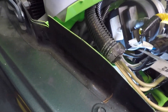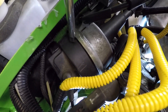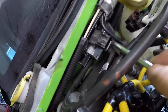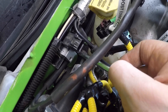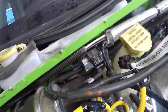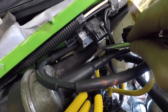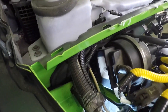Off of solenoid one, there's a gray line which goes back around the cruise control unit. That gray line comes around and plugs into the MAP sensor that's on the firewall. By the way, some of my equipment might look different than yours because of the year and changes Chrysler may have made in how they were routing hoses at the factory. There's that gray hose plugging right into the MAP sensor.